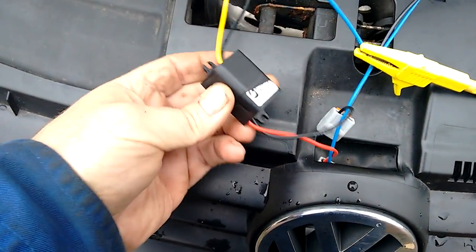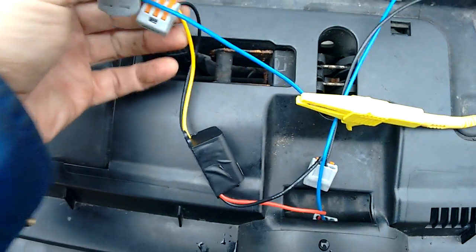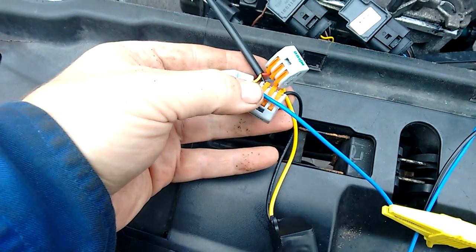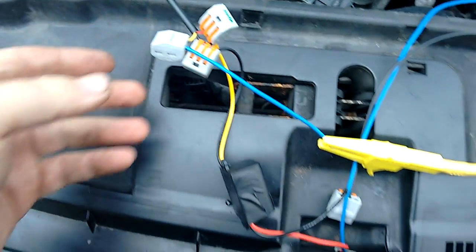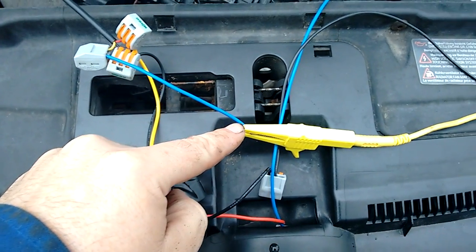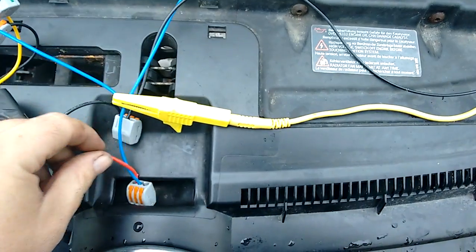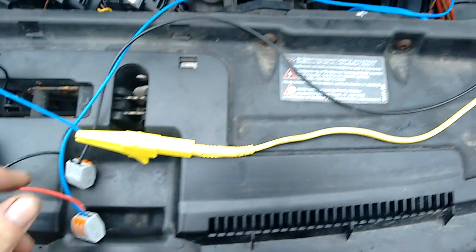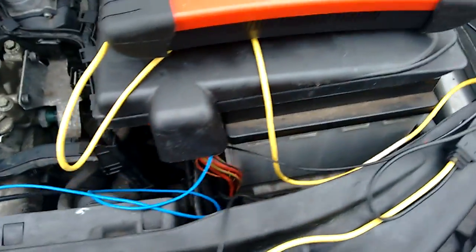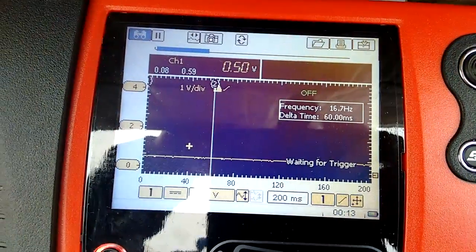Following the red and black wires: red is 12V from the battery, and black goes to the earth on the battery. Back at the transducer, that yellow goes to — I've got a little blue wire there, so it should really be yellow — but it goes to my yellow lead. I use these Wago connectors, you can get them off eBay or Screwfix. The blue lead goes to 12V positive and that's the meter powered on.